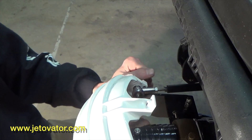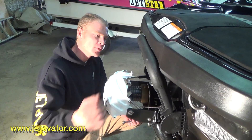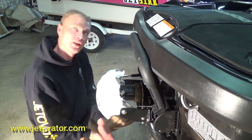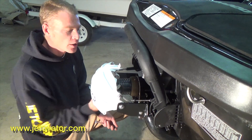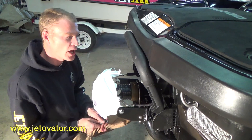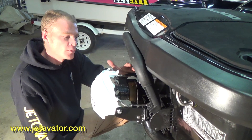One thing about the Sea-Doo RXT 260 is the amount of travel forward and back that the reverse bucket motor has pretty much makes the little bump stop bushing on top of the bucket unnecessary. The reason being is you have about an inch from the bottom of the reverse bucket to the top of the ring here. When you start it up for the first time, you might want to leave this nut out of your reverse bucket. If you put it in forward mode and the bucket comes up but you don't have the measurements close enough on your steering shaft, the bucket will bind on top of the thrust adapter and the steering nozzle — so that's something you want to avoid.